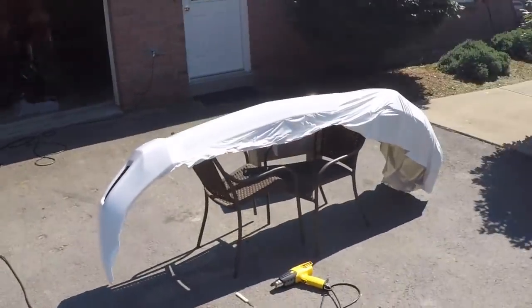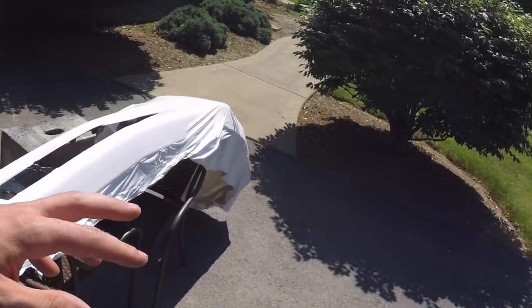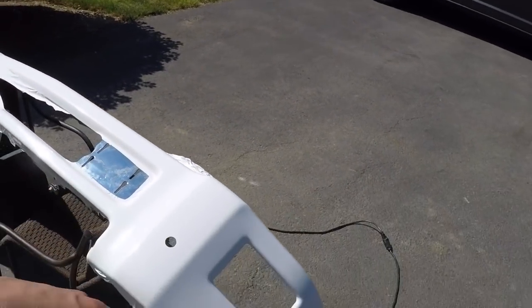Let's get into actually wrapping the bumper — the reason you came here. This will apply for pretty much any vehicle. I had yet to see a video on YouTube of someone wrapping the front bumper of one of these newer ones, so I wanted to put it out there. Tools you'll need: first, the vinyl. I went with a 25-feet-long by 5-feet-wide sheet — way too much. About a quarter of that is what you need. I went with 3M 1080 vinyl, which is quality stuff commonly used for automotive applications.